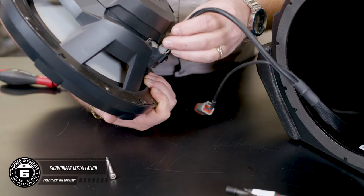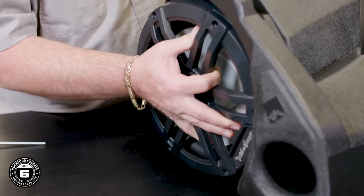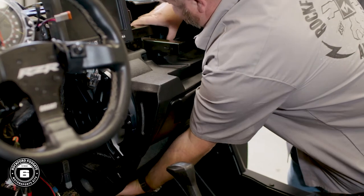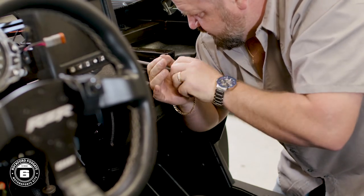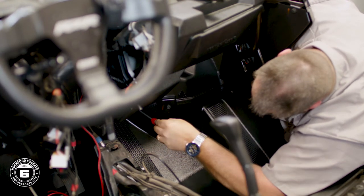We're ready to install the subwoofer. Attach the two Deutsch connectors — the two-pin is for your sound, and the four-pin will connect to your new Color Optics controller. Now load the subwoofer into the enclosure using the supplied hardware and Allen bit. Your subwoofer is going to replace your glove box, so it will use the existing hardware to mount to the crossbar as well as two additional mounting holes that line up with factory standoffs on the firewall. Slide the enclosure into place, secure it with the existing two screws — keep these loose so you can line up the two mounting holes on the bottom, secure those with the provided hardware, then tighten all four mounting locations. Once the enclosure is mounted, plug in the harness and run it to the center area.